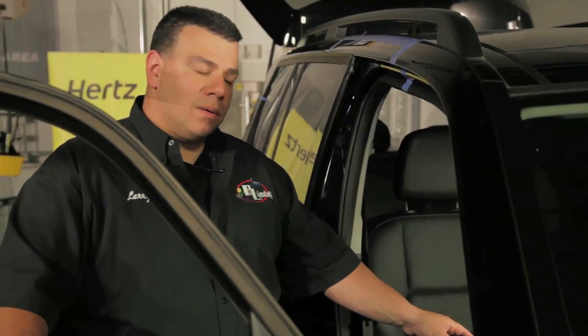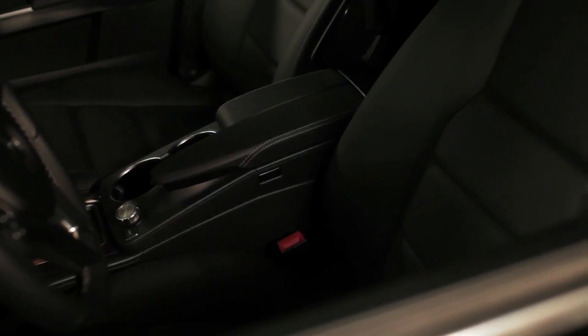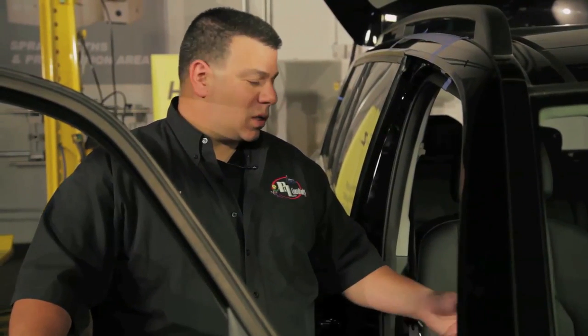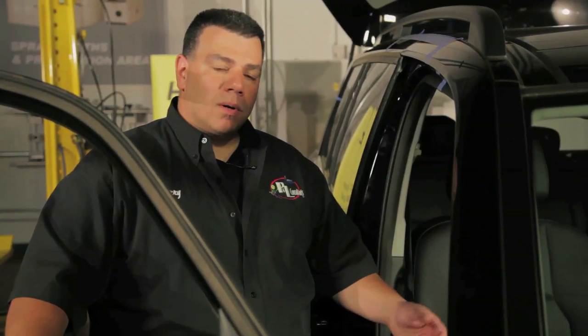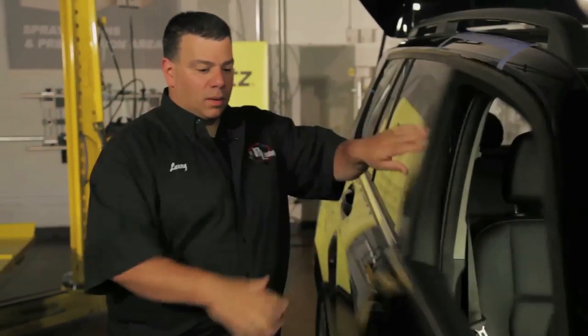Additionally, check the height of the buckle to make sure it's not compressed or collapsed. You can check both sides. Some seatbelts just have a metal bar, so there's no need to check those. If you see an accordion-like area surrounding the outside of the seatbelt buckle, check whether it's collapsed. Also check the manufacturer's documentation to see if it has a compressible buckle assembly. After finishing this seatbelt, go around and check the rest — that's what the normal procedure calls for.